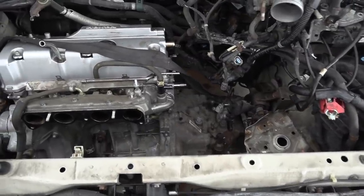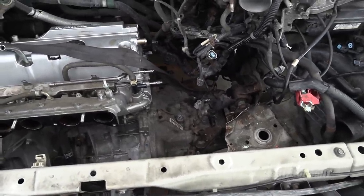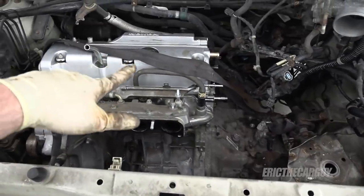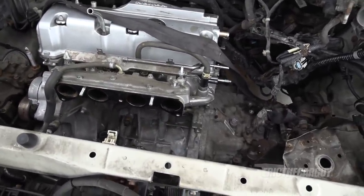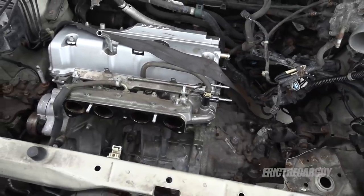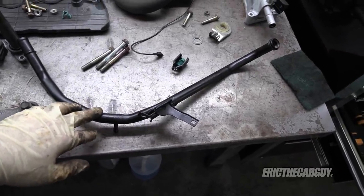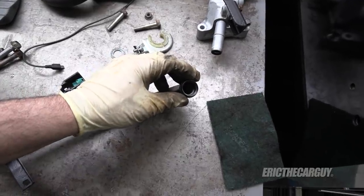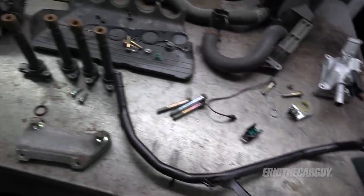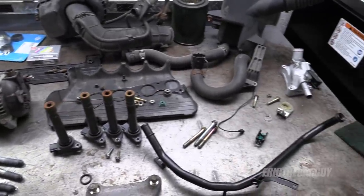Given that I've already covered disassembly in detail, I'm not going to cover the assembly in as much detail — I'll probably give you another time lapse of that. Get this all together. I'm sure you want to know what I want to know: what it's going to be when it fires up. When I get the valve cover off, I'm going to check to see if it has any oil in it, empty it out if it does, and then pour my oil in with the valve cover off over the valve train to make sure that's all lubricated — timing chain and everything as well. Additionally, remember that rusty tube that I took off for the heater hoses? Well, it's been reconditioned and I've taken the new O-ring and put it on here. I also went through and sandblasted this piece just because I thought it would look better.